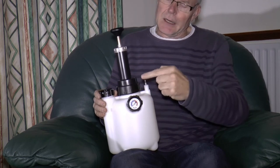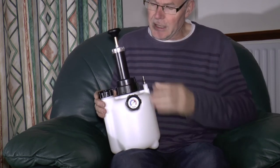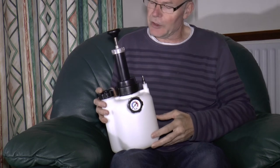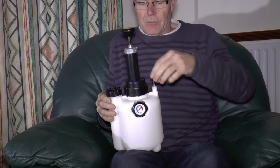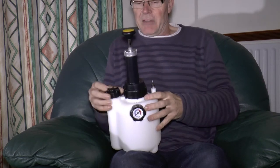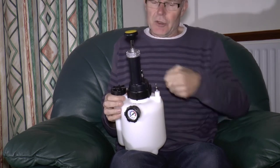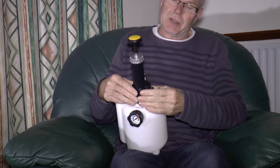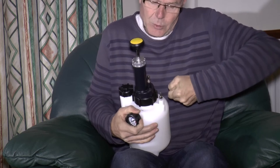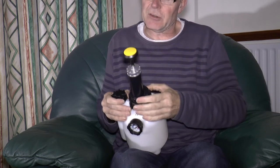Finally it can leak from the main pump to the vessel attachment point where it's screwed on. This thing, I kid you not, is assembled by Arnold Schwarzenegger — they've done it up ridiculously tight, and I suspect they've done so to stop the leaks rather than just putting some sealant on the rubber gasket. To get it off, I removed the compression fitting and the silicone pipe and the lid. Then wrapping some cloth around the cap, I used a motorcycle oil filter chain wrench on it to get it off. You could use a strap wrench or put it in a vice — just protect the lid because it's brittle plastic. With the chain wrench around it and grasping the bottle with even force rather than yanking, it gradually came undone, and once loose by about a quarter of a turn it comes off reasonably easily.